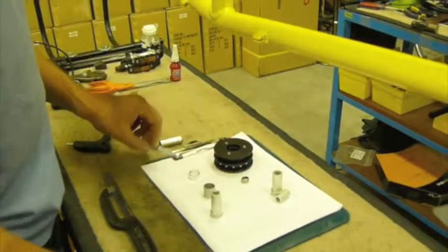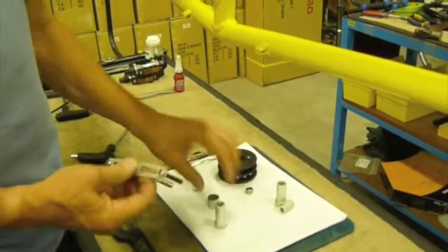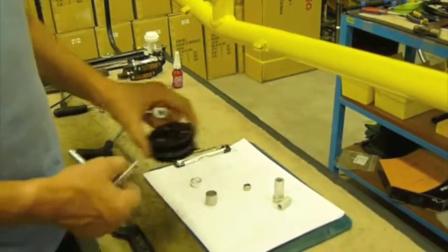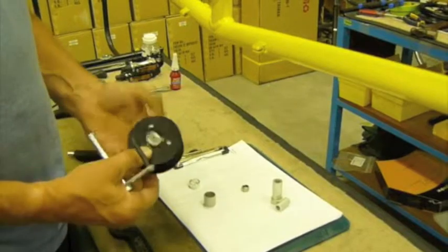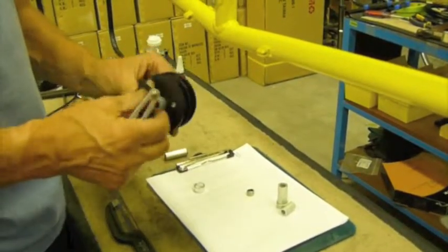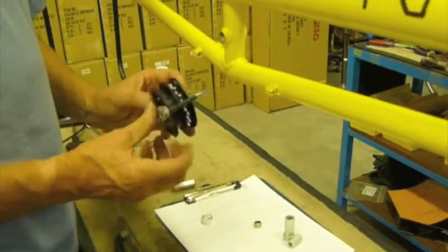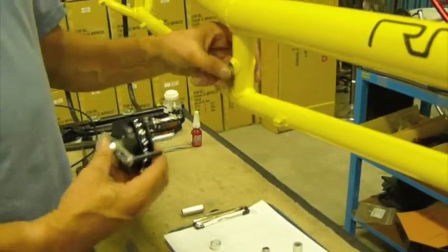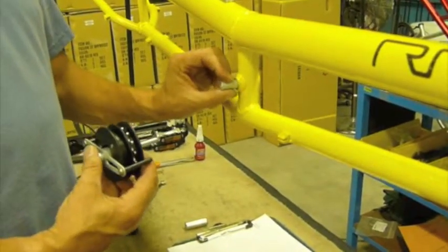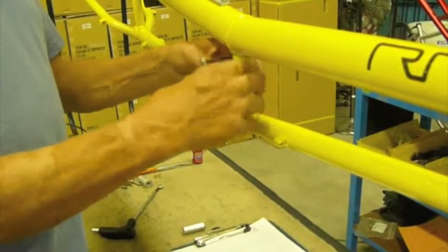So we've drilled out this guy, and we're going to put that on there. We go ahead and slip on the idler like so, with the sprocket to the inside, then the original spacer. Now you've got this whole assembly going together. And then inside of here, we'll put one of these — which we already have — and we're ready to bolt it off.